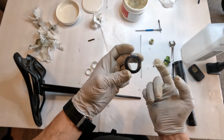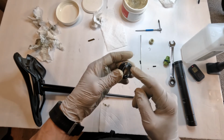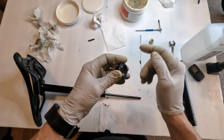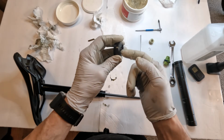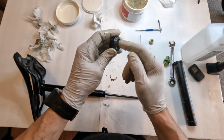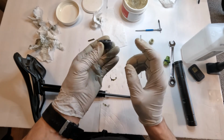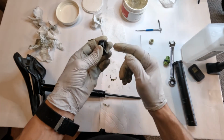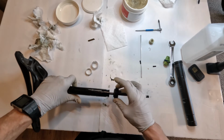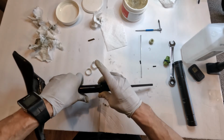So first we're going to take our guide, our wiper, right? And just like wipers on forks, it's concave on the inside, and we are going to fill them up right in the inside over there. Put a good amount, don't be afraid. On your first couple of rides, a lot of it will come out. Just wipe it off, and then you will be good. You do not want to go short on grease here, right? So take this guy, put some on the bottom too, why not? This never hurts. So, and we slide him in. Right, done. Should have went the other way first.